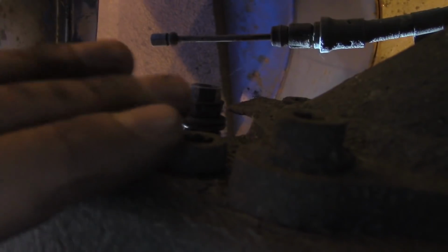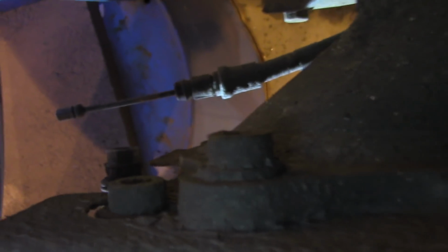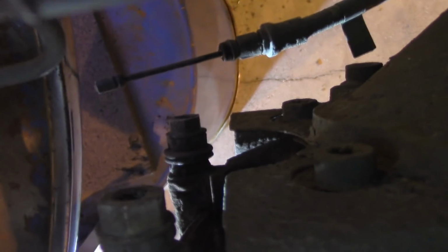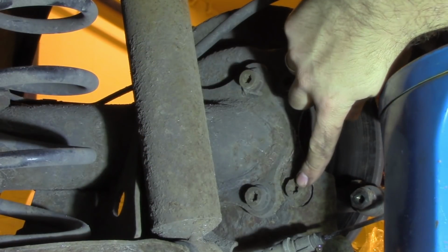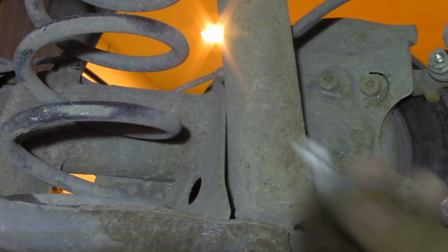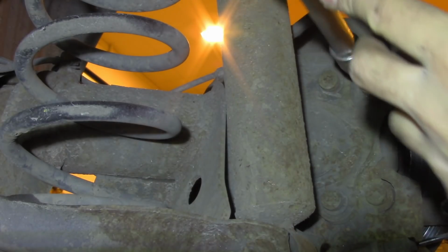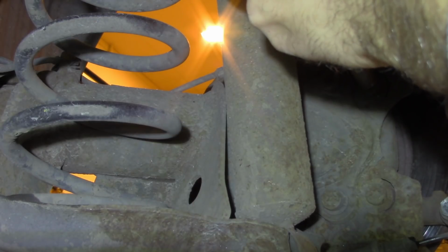Yeah, you see one here, but I'll just put the camera on the other side of the braking disc, and then you'll be able to see that much clearer. Yeah, there's the other one there. Okay, I was talking about these 2 bolts. Their interface is star-shaped, size 50. Okay, so we take our Torx interface, put it on the extension, and we work on our interface.